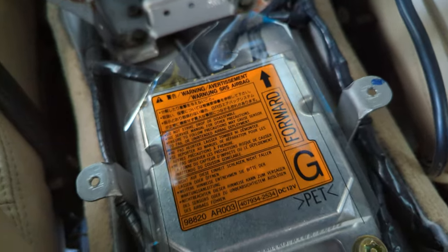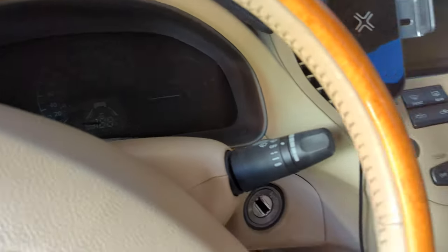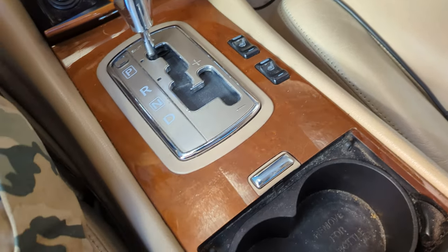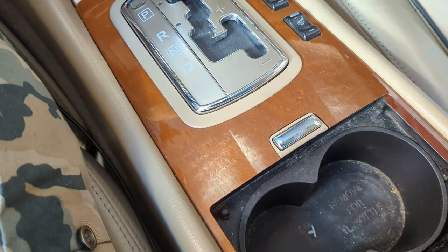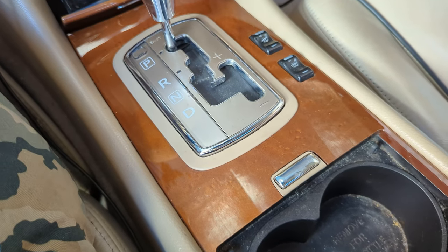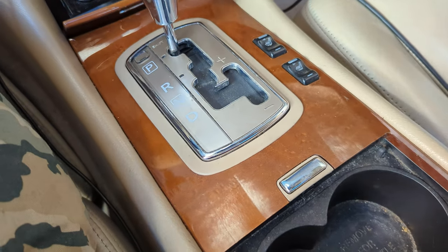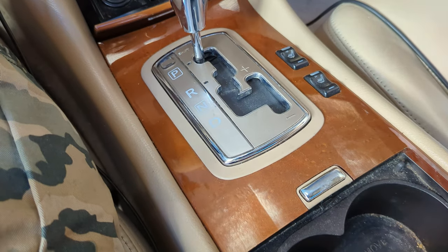On this car you will have a slip light as well as VDC off — this button will no longer work and it will be disabled fully. That lets you do burnouts and thrash the car. I'm not sure if it will let you do a burnout on dry ground — you might have to do the brake light mod for that — but at the track in the water box it had no problem. I just wanted to show you how to disable the yaw sensor. I appreciate you guys watching and I'll see you in the next one.